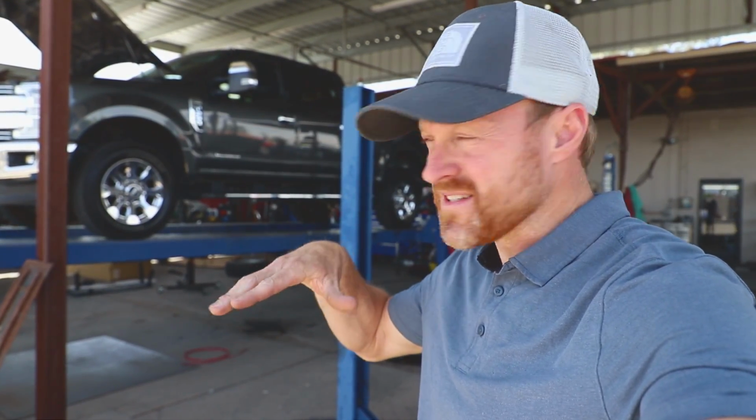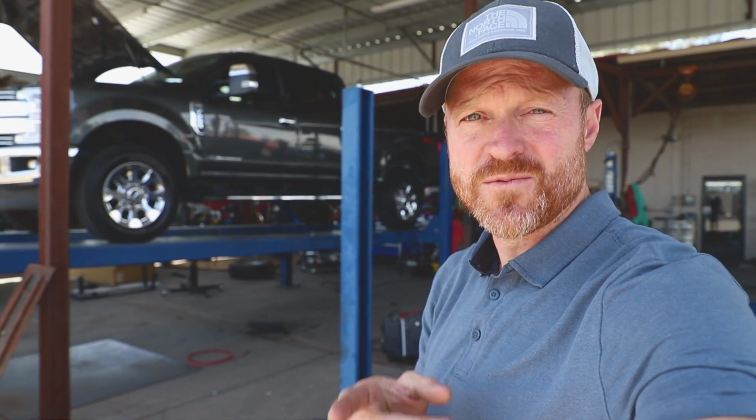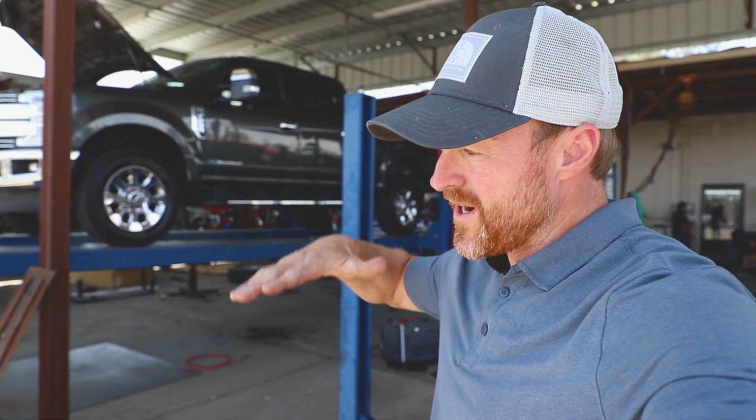But most importantly, the truck is designed with the cambers and such that's inside the truck. It's designed to be level, so it steers better and it's safer. But there is an important consideration when you're doing air. When you have a weight distribution system, especially with the chains, you raise up the trailer and you tighten everything up and then you drop it down.